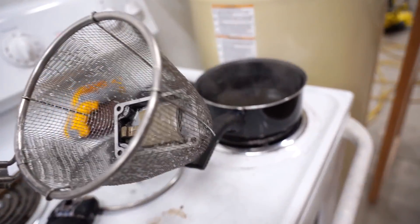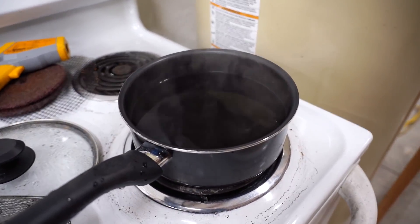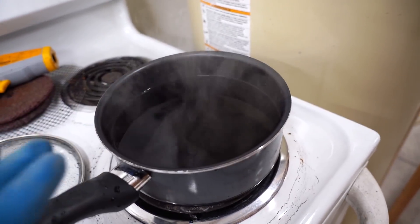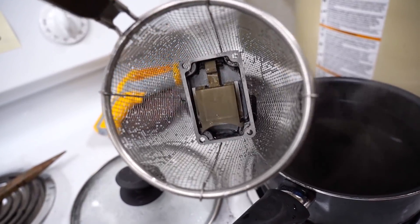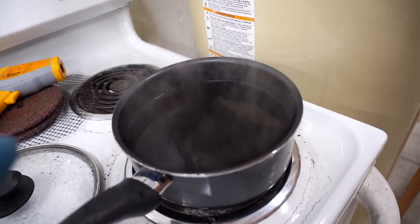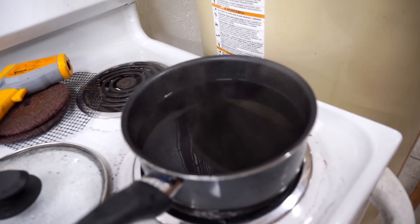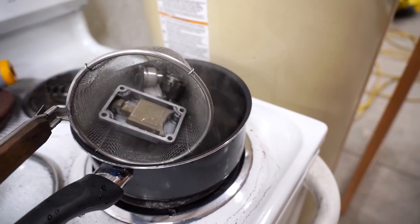What I've got here is some water with a little bit of Simple Green degreaser at a rolling boil. It seems like heat is what helps loosen up this carbon. Obviously if you're going to put anything at a boil like this, especially a degreaser, you want to make a hundred percent sure that it's not flammable. So let's give this a shot.